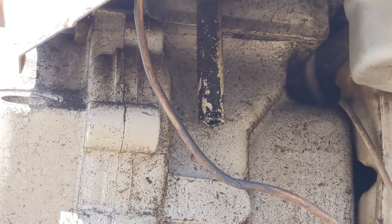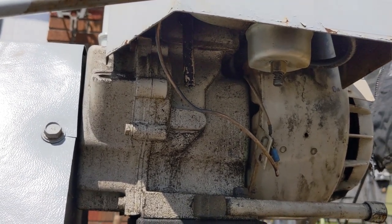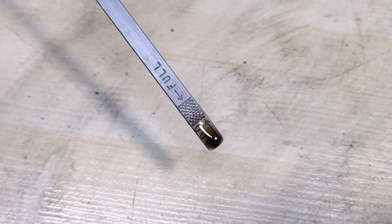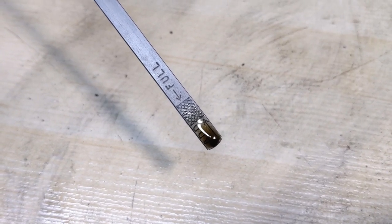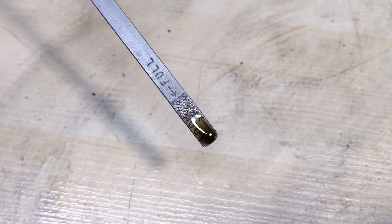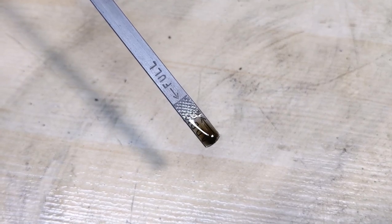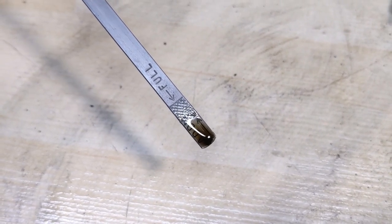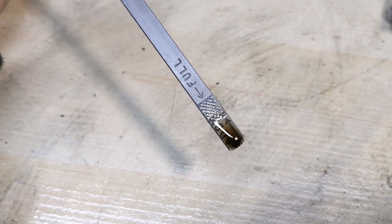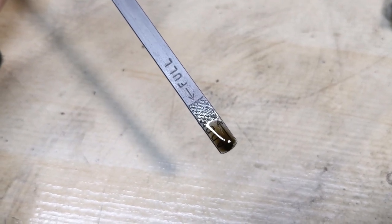You could imagine that if this was hooked up to an air box with an air filter, you're going to get a little bit of extra engine oil vapor into that air box, thus clogging up your air filter. Now, the second thing you want to do after removing the air filter and noticing there's a bunch of oil in the air box is remove your dipstick and just verify what the oil level is. Sometimes customers are going to overfill their engines with oil. One of the things you're looking for is to make sure that it's not overfilled. What we can see here is that the oil is a little low — obviously, because it's been venting into the air box — and it's a little darker in color, so it could use an oil change.